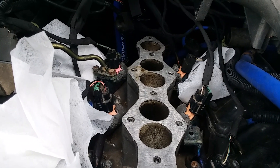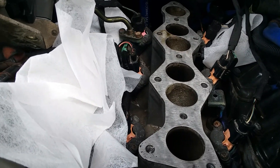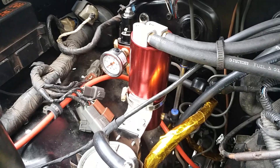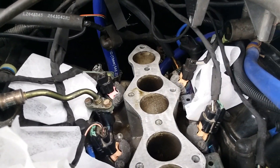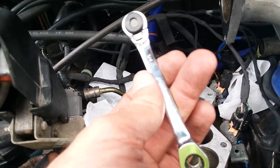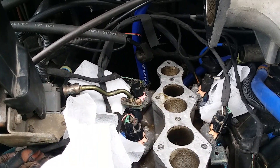I'm just getting really tired of taking this thing apart — I'm so sick to death of taking it apart for no reason other than we just keep chasing ghosts around here. Leave me a comment down below, like, share, and subscribe, and hopefully next video we'll have it actually functioning and running so I can move on to more suspension-related items. To get to the fuel pressure regulator the first time, the screws are probably going to be a pain — you can use a 90-degree ratcheting tool, but I wouldn't be surprised if you actually have to pull the rail the first time and use an impact gun to get those screws loose, just because they've been on there so long.